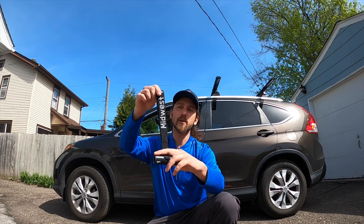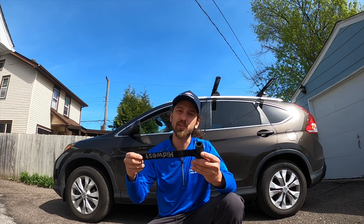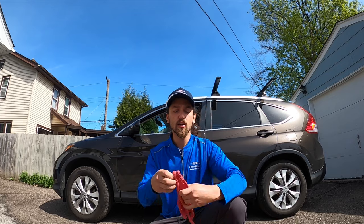I'll be using cam straps today. I'm also going to use hood loops — these tuck right underneath the hood of my car and let a loop come out for my bow and stern lines. You might already have tie-down points like a hitch on the back or a towing point on the front, but hood loops are a cheap, simple solution — four of them cost me about $25. I've also got some cord for tying the bow and stern lines, and finally a red flag because my boat will be sticking off the back of the vehicle.